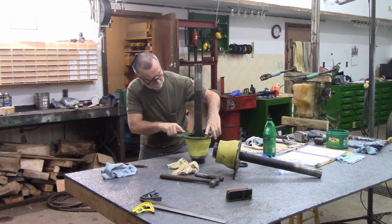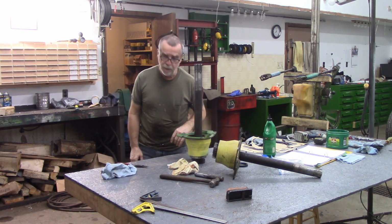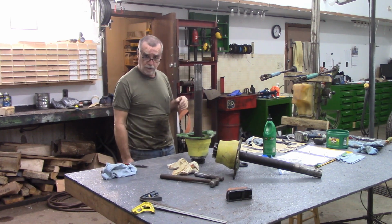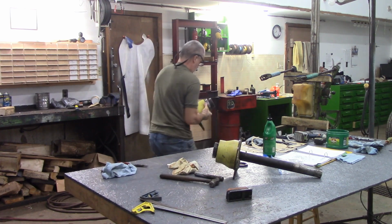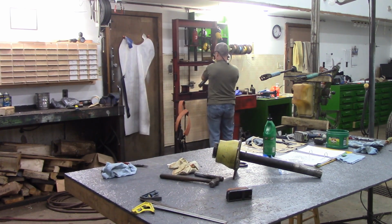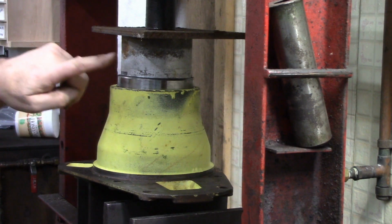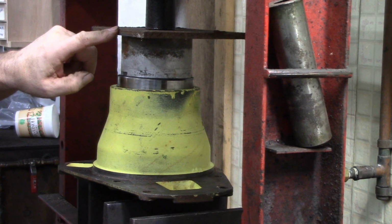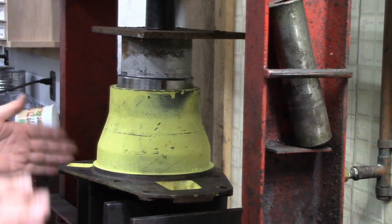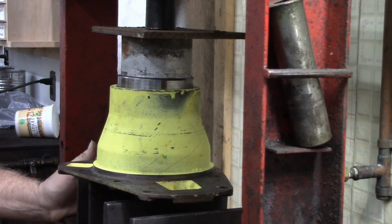Yeah, I got these three surfaces here that are flat, and I can probably find something to push on the outer race of that bearing. Let me see if I can get that set up, and then I'll rearrange these cameras. Alright, I found a chunk of pipe that's pretty close to the size of the bearing and cut myself a little chunk of that, and I got a little chunk of plate on top of that. Pretty close to square, I think.